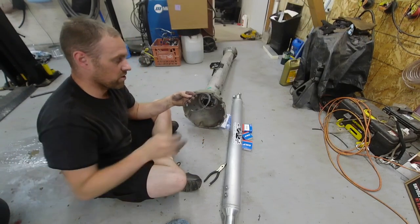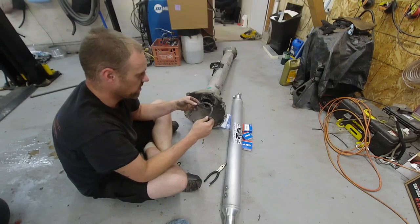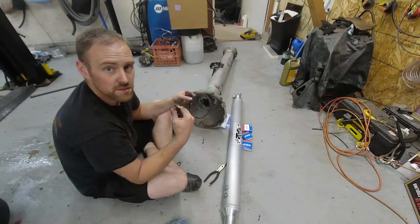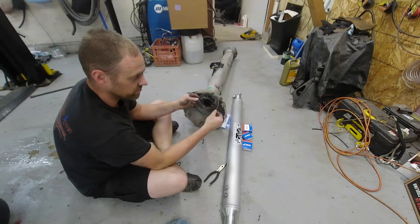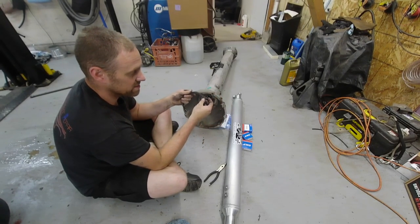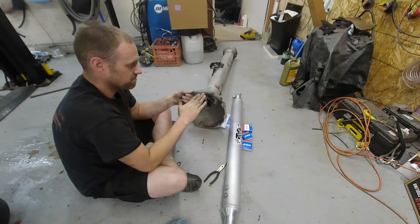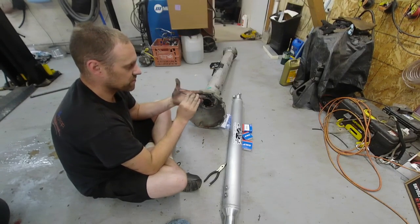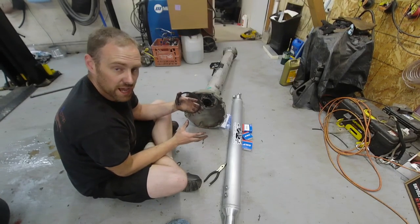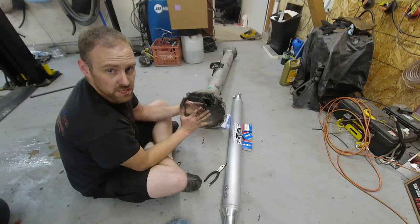Here's the snap ring. The snap ring is direction specific — if you put it in this way, it's correct; this way, it's backwards as far as front to back. You can feel a taper on the edge: there's an angled edge on one side and the other side is flat. You want the angled edge facing the outside. When it snaps into place, it pushes everything in and holds it a little bit tighter.